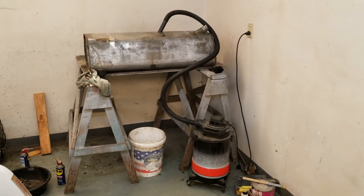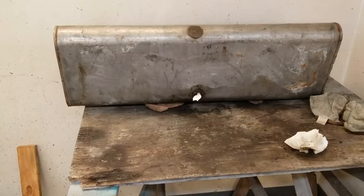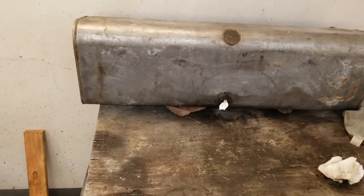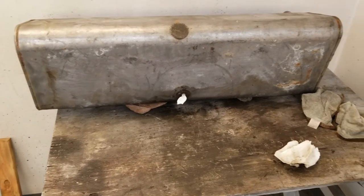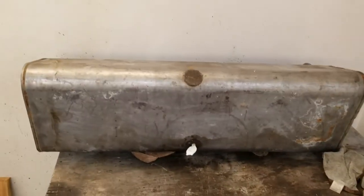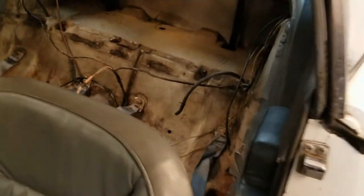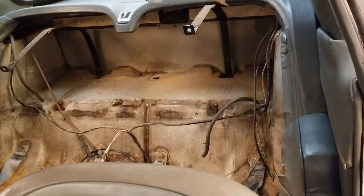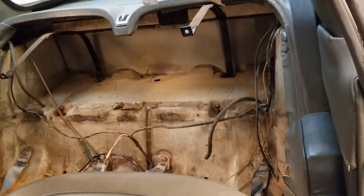Giving it a final dry before I put a little gas in it, swirl it around, and then we're putting it in. I have now rinsed the tank out with gasoline just to coat everything — I dried it first, then did that. I thought I'd rather leave a little film of gasoline just to keep things good before I fill it up with real fuel. Now I've got to fit that into the car, get things cleaned up, and stuff it in there.